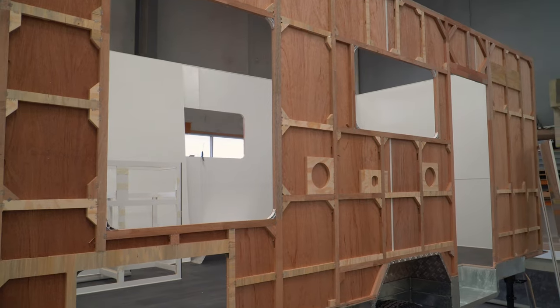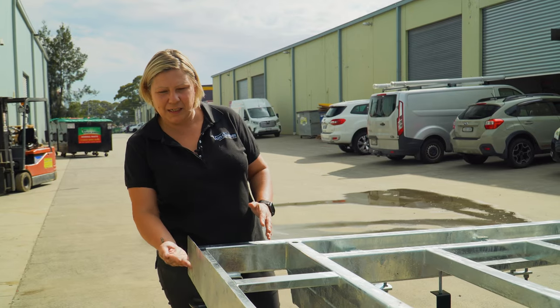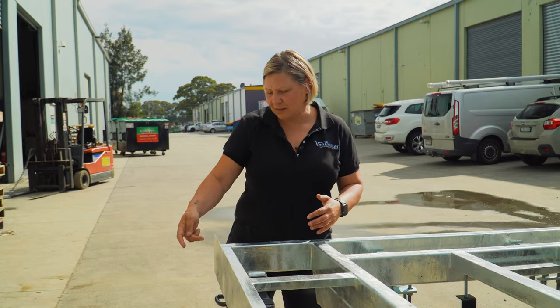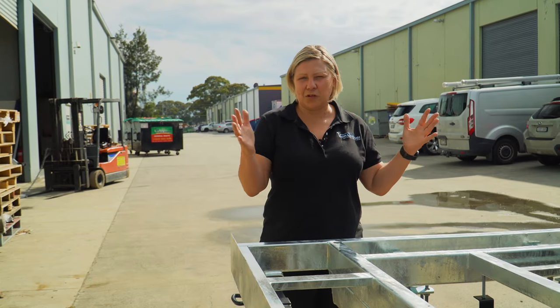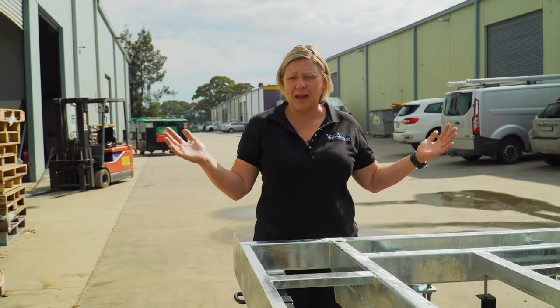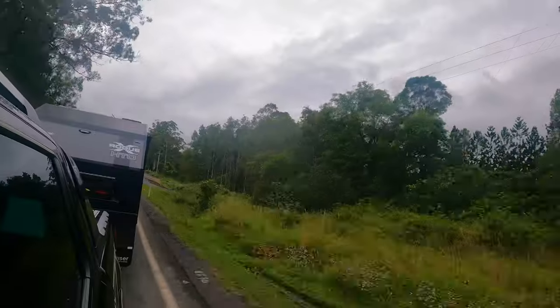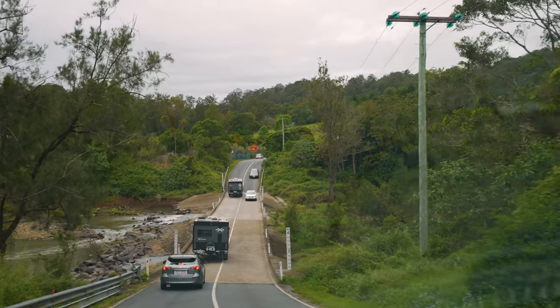This outrigger here protects the walls, so the structure is not sitting on the outside — it's actually sitting on top of the chassis, and it's screwed in this way and this way, and that's giving the structure a lot more strength. Where you are going off-road and there's a lot of fatigue and movement, the walls are actually flexing with the chassis, as opposed to being on the outside where they tend to have a lot more movement throughout.